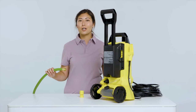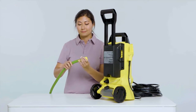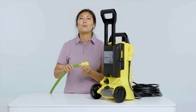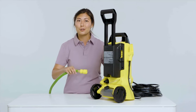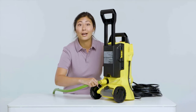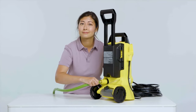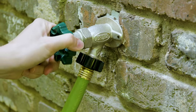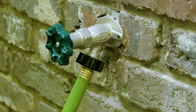At the other end of the garden hose, attach the yellow piece from the adapter. Once it's connected, you simply push it into the black adapter piece on the pressure washer. Press firmly — you should hear the two pieces click into place. Now you can turn on the outdoor spigot. Make sure it is completely and fully opened.